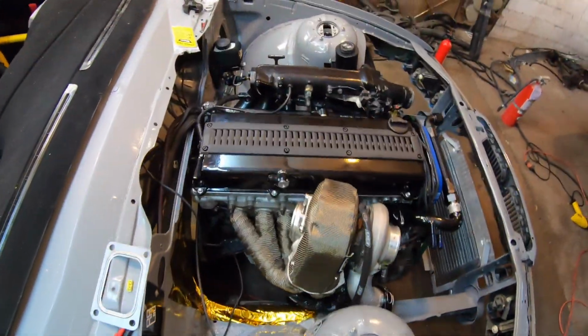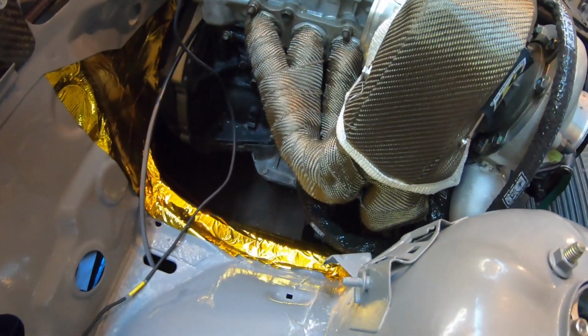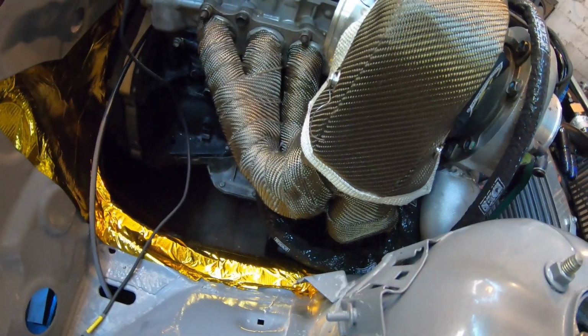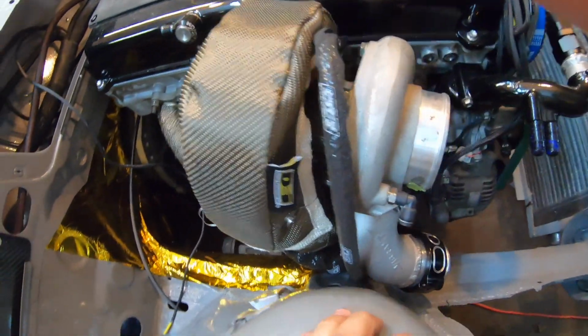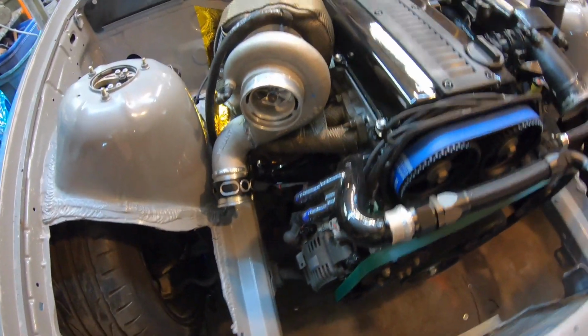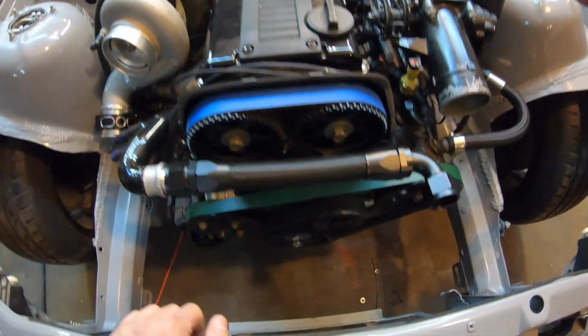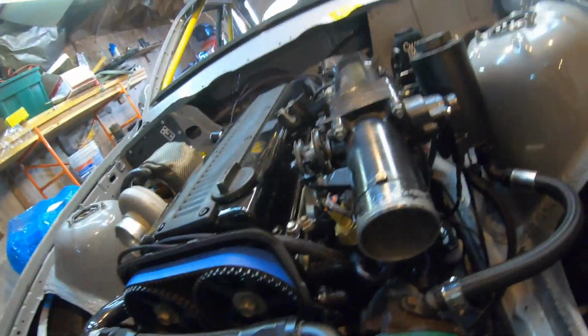And yeah. So pretty much the engine is a stock 1J, head studded with the Cometic head gasket. We got a tubular, I think it's like one of the Rev 9 cheap manifolds. I heat wrapped that, heat wrapped the turbo. It's a Borg Warner S257 SXE. Small turbo, should make my goal of 450. It's got a Greddy timing belt. I did a SFI dampener just because I didn't want this thing flying off, especially after I spent all this time on it.